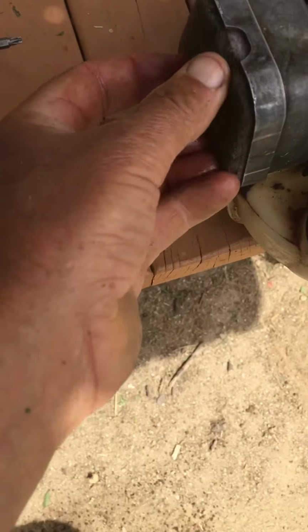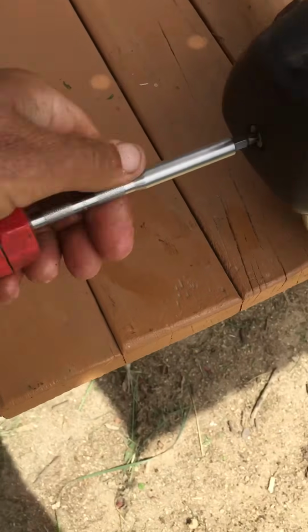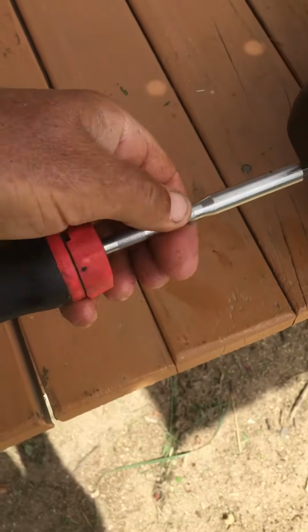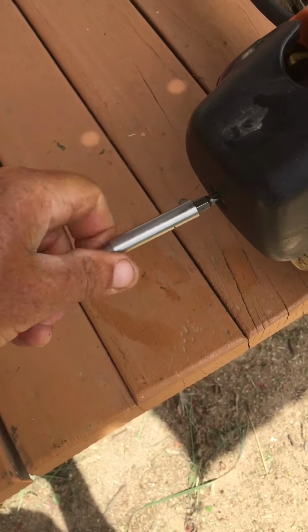and anyway, I tested it after trying everything I could possibly think of, just about to give up, and then I found that when I was pumping the primer bulb, it would actually surge like it was temporarily starving of fuel, like the opposite of having the choke on. The choke would kill it when it was running rough, so I knew it wasn't running lean.